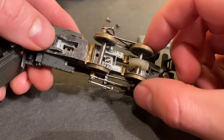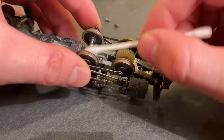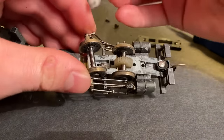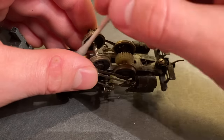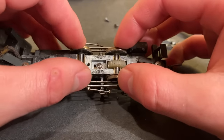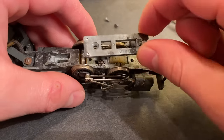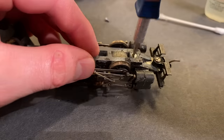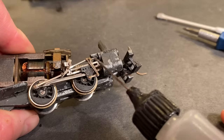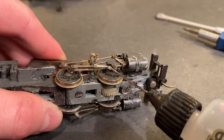There's like a little bit of oil in here and everything, but that's nothing bad really — it's just a little bit of dirt. I've seen way worse. I'm just going to take a Q-tip with some 90% rubbing alcohol and clean off all the oil and carbon, whatever crap is in here. There's a bit coming off. It's not completely clean but I've seen far worse — it's already looking a little bit better. I'll get everything back into place and add some oil, seal that back up. We'll also oil the drivers and all the other components because those could be sources of issues too. Pretty much, if you've got a moving part, put a little bit of oil on it — it probably will not hurt. Except the commutator.